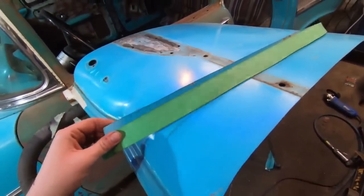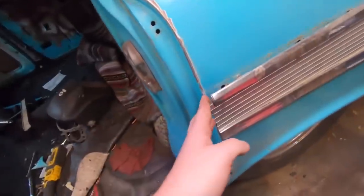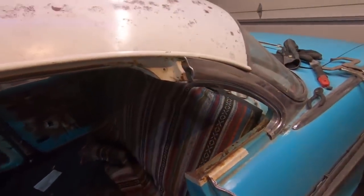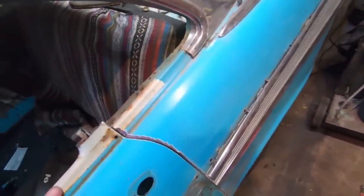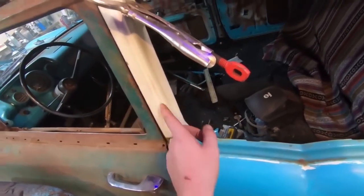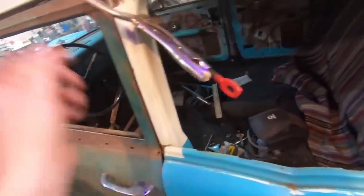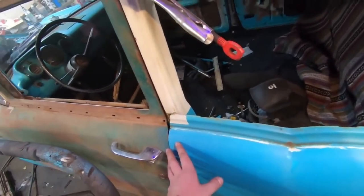Here's the progress I've made. I measured, taped my little piece off — that's just the excess, basically the panel. I went around the edge and peeled off some of this trim, but the problem is it's actually all glued on, so I'm just going to kind of peel it back gingerly. Same with the top — I got it kind of half out. This panel now fits pretty decent. If I get it kind of lined up with my knee, it's tight on the door, which is good. So I'm going to get a few tack welds in and make sure I'm happy with where it is.